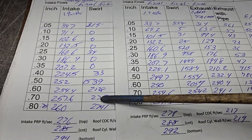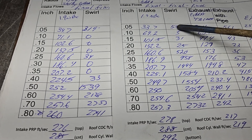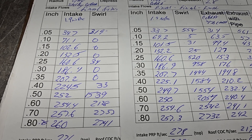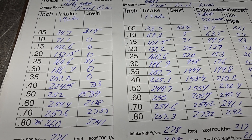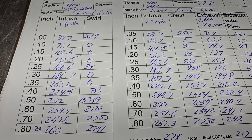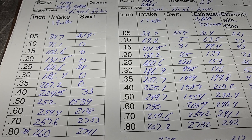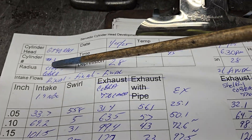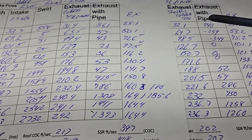Let's do the swirl first. We got plenty when we go up. Now this one was a little bit different — it was a little more progressive. We're going to take a look at what the intake did through the manifold, carb, and all of these are being tested through that Wilson four-hole spacer. Four-hole tapered manifold was actually designed for that. This is number three, this is number four — we're comparing these flows to these flows.